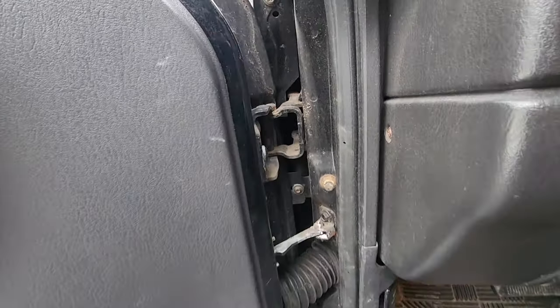But why is everything failing? What is that? Oh, here we go. Status. Okay. DTCs. We got one. It's all ready. Everything is ready. Readiness complete 7, and not complete. Okay, so it passed all its monitors. This thing will pass inspection because there are no check engine lights, but we have something to address. What is it? Can it tell me what it is? I don't know. What's IM do? I don't know. Hit OK. Okay, let's read codes. All right. Processing.